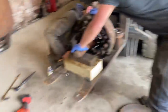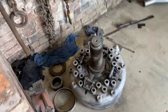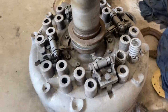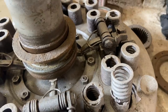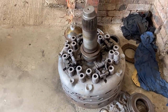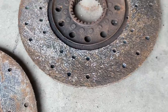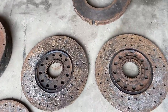This is the clutch that came with the donor engine - in a lot better condition than the original Centurion clutch. The original one that was in the tank has got the escapee spring, and we're not quite sure of the condition inside - several of these have rotted as well. With the Meteor producing about 650-700 horsepower and probably thousands of newton metres of torque, we were worried about using that clutch. This donor one, despite having been stood a while with the disc a bit rusty, looks in reasonable condition - with a bit of cleaning up it should work.